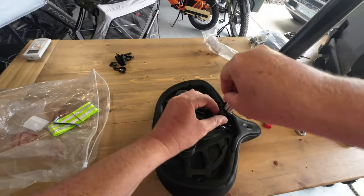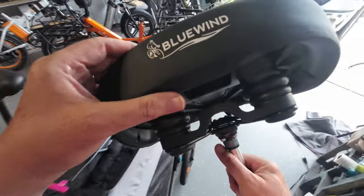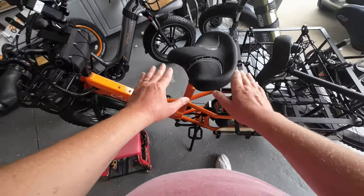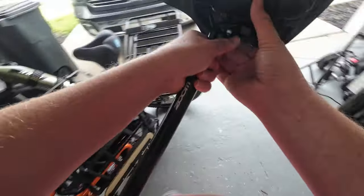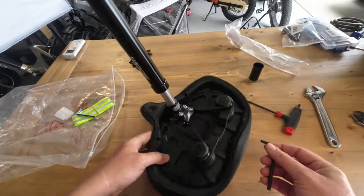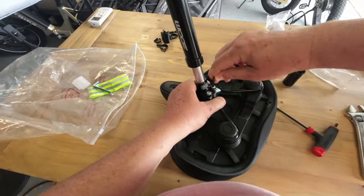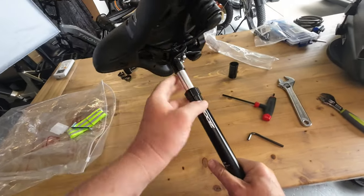I know about where I like mine, so we're going to leave it right there and keep that same angle. Tighten down these screws — it's not going anywhere. Before we tighten it down all the way, I'll check one more time just to make sure everything looks good. You can tighten it down further if you want and actually hop on the saddle. It's looking even with the bike, maybe tilted slightly backwards, which is fine. I just don't want it tilted forward because then I'll feel like I'm falling off the front. Now crank down on these pretty good — use the smaller end of your wrench so you can get more leverage. And there we go, that's all she wrote. We've got a new suspension post installed on the new saddle.